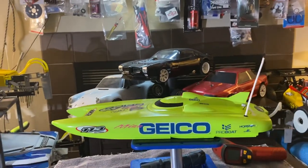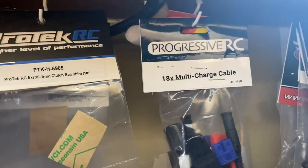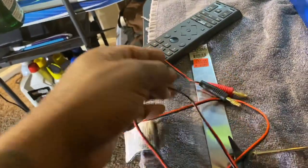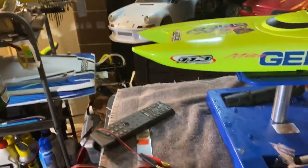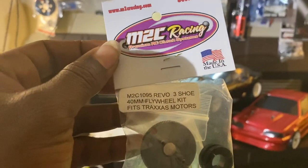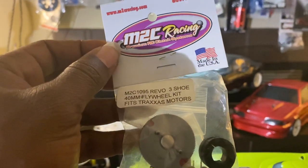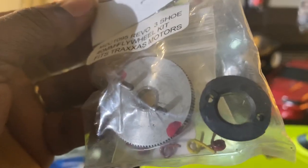Another thing too — if you're running electric or anything that you got to charge, you want to be using squids — Progressive RC, so instead of having to switch adapters, boom, just do everything. That thing's got everything on it. Another thing I just upgraded to: I went to an MTC clutch on my Traxxas. It's a 40-millimeter flywheel kit. If you're going to do this and you got a stock car, you got to shave the front of the car if you want to be able to take it off. That's a stock clutch shoe, two-shoe with the spring in it, stock flywheel. If you're going that route — 40 millimeter is just two millimeters too thick to pull your carburetor off while it's on the vehicle.